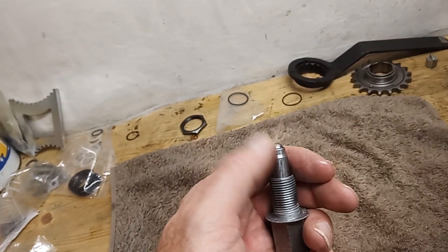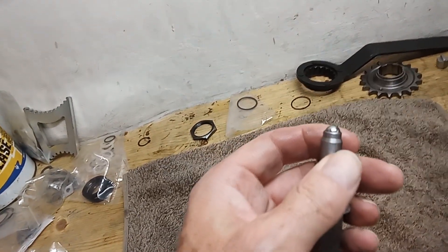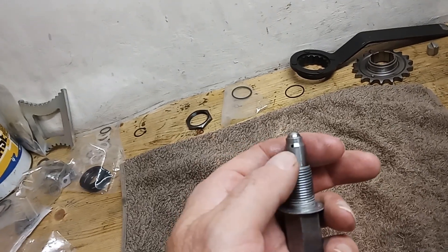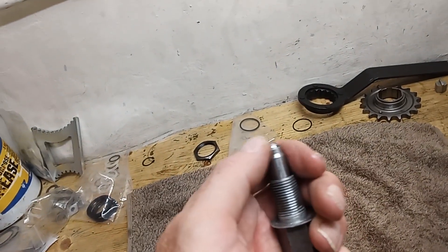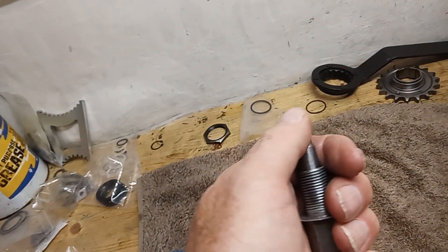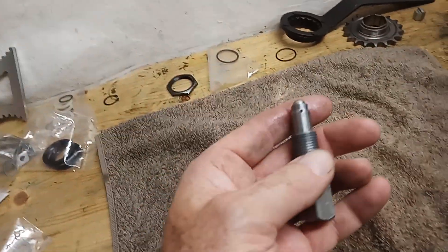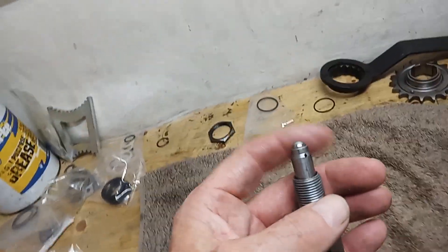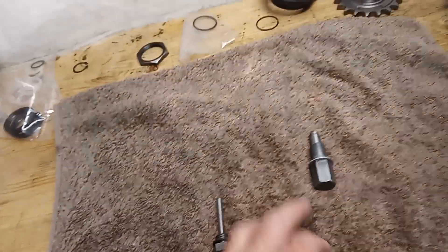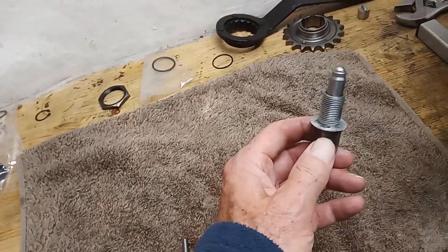This just helps them move that bit more easily, so I'd always recommend changing to a ball-tipped plunger. He advertises mainly on eBay - if you look up 'ball-tipped gearbox plunger' or 'Triumph gearbox ball-tipped plunger' you should find them. Not that expensive but always worth the little upgrade. I'll screw that back in and probably put some thread lock on as well to try and stop it leaking.